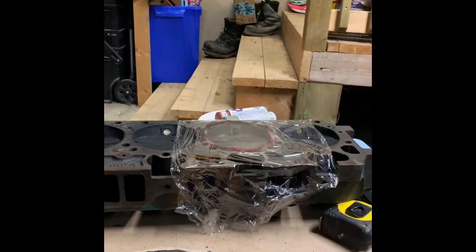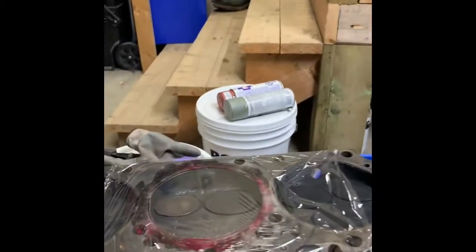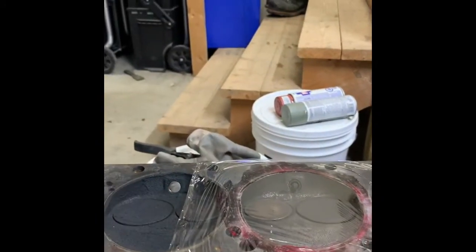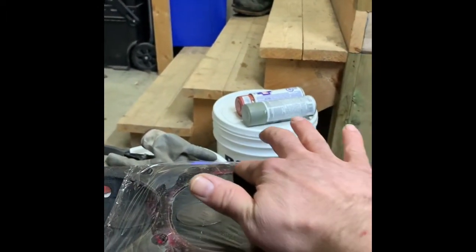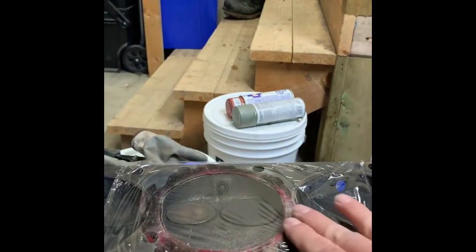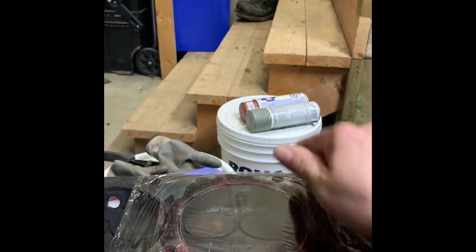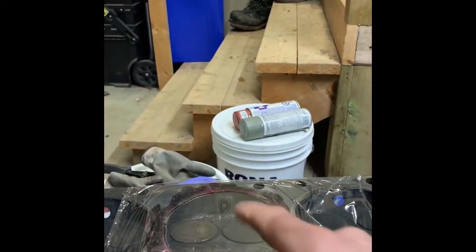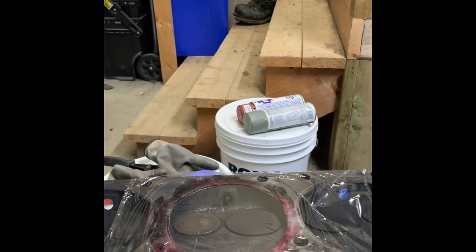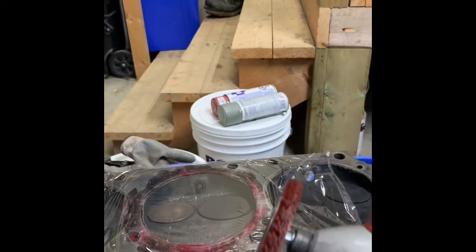So I'm just going to quickly try and CC one chamber. This is a 906 head. It's set up mostly level — level this way up. I just put a little layer of grease on there and saran wrap, because I couldn't find any kind of hard plastic. Let me give it a shot and CC the volume. The spark plug's in there — it's tight. I just took the carbon out with a little brush here.